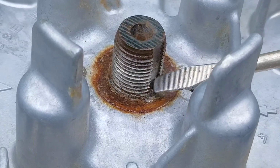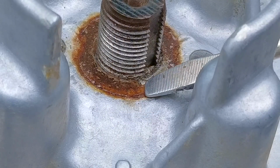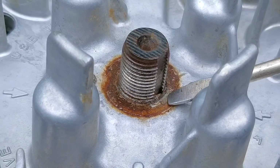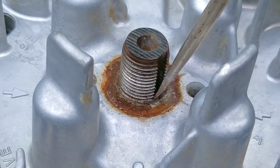After getting the large nut and washer out of the way, you can now see the keyway in the crank and also the top part of the key. Now they should be lined up, but as you can see, part of the keyway is over to one side instead of being lined up with the keyway. That means the key is definitely sheared and needs to be replaced to bring the timing back to normal.